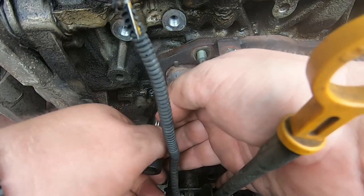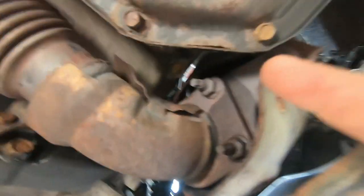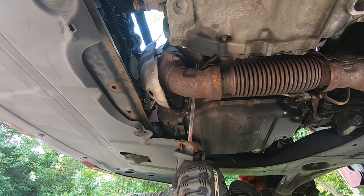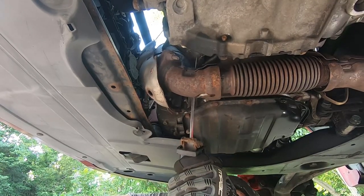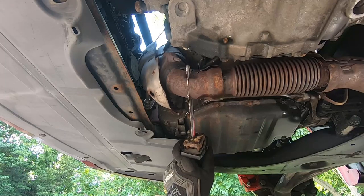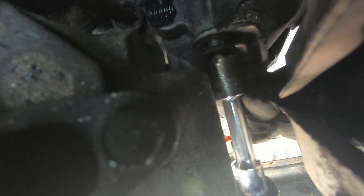Get all five bolts off, then go ahead and remove the bolts that connect the catalytic converter assembly to the down pipe. Mine were rusted, so my brother stepped in with a hacksaw and made quick work of it. The whole exhaust system was 13 years old and those bolts were rusted through. Once you make that cut, there's only one more bolt left — connected to the exhaust manifold itself — it's a 13 millimeter bolt and it was difficult to get to, but not impossible.